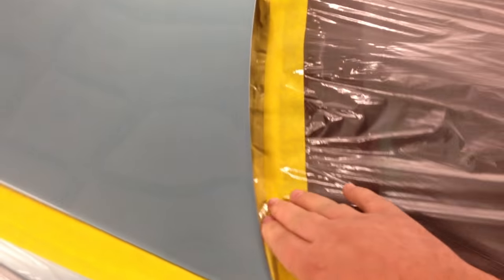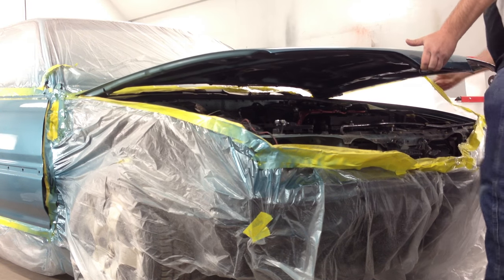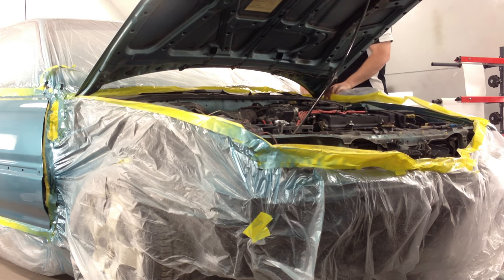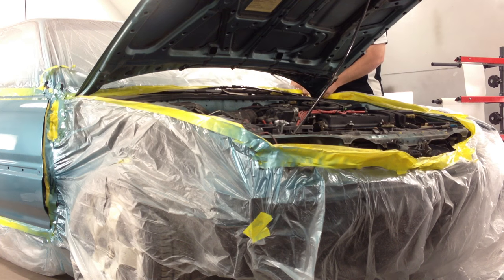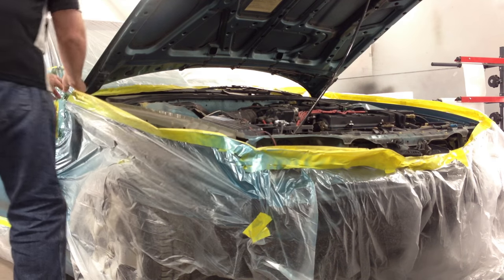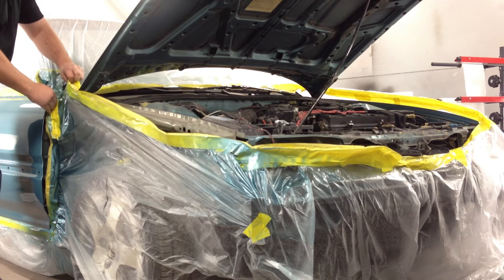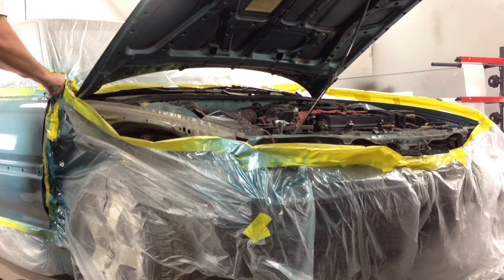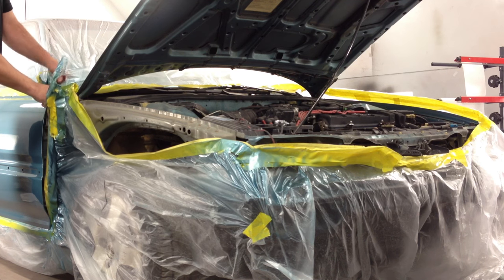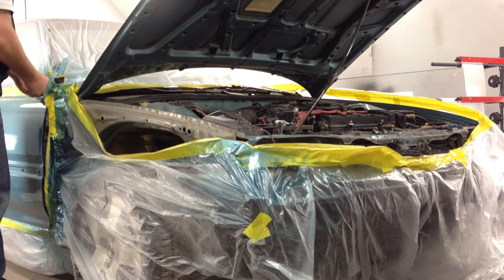We're going around, just getting all this pushed down. Once we get it all pushed down and away, we can lift the hood and start removing all the plastic. We did use just plastic on this job, but that can be a problem — I have seen it where the air pressure hits that plastic, it moves around, and some of that paint, primer, or sealer might pop off and flake into the finish. But if you keep the plastic pulled tight and use that adhesion promoter, you shouldn't have a problem. To be safe, you might still outline it with some 12 or 18 inch paper and then put your plastic on that.